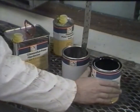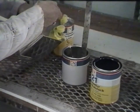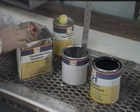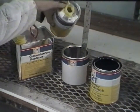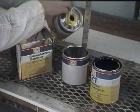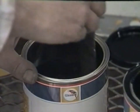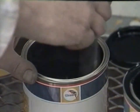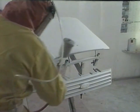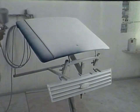The first two components to be top coated are semi-rigid and so require no soft face additive. Simply add the hardener and thinner to the 21-line colour as normal. Depending on the choice of hardener and thinner combinations, two to three coats of 21-line should be applied to achieve the desired gloss level, flow and build.